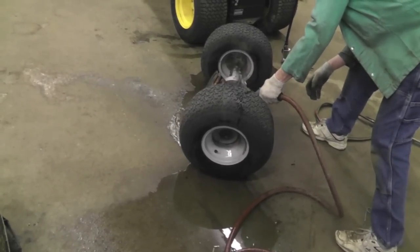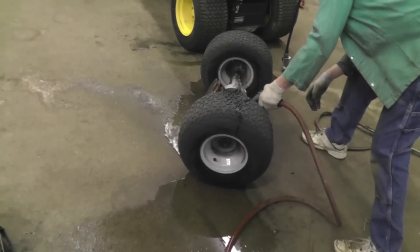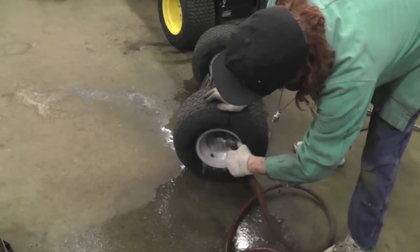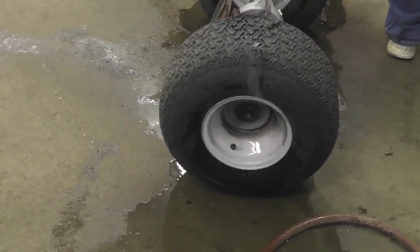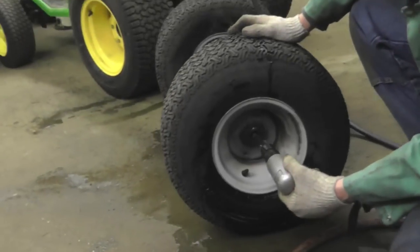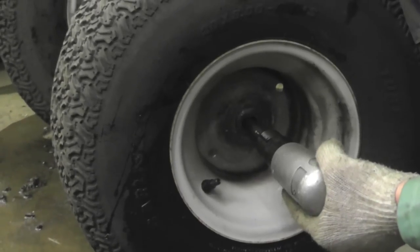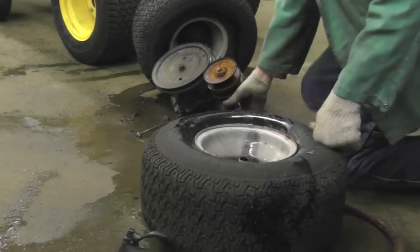Sometimes you've got to do this a couple of times on these wheels. Once you can get it to move, get it nice and cooled down, then get your air hammer. Put it on that bolt or the center of the shaft — this one's the kind with a clip on it. Look at that — it comes right off! You can see that little rusty shaft.